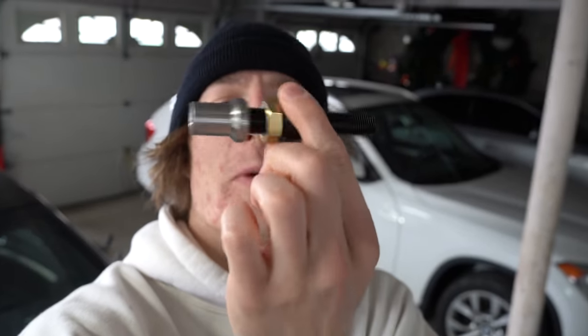I got my metal - I was going to use some stainless steel, but we got this metal right here, and I got these double adjusters. I had existing bungs, we got a 5/8 thread on here, so these things are nice and thick. We're going to chop the arm in half, cut some length off, put this right in the middle so we can thread in or out. We'll have some sick camber arms and this only cost me $18.